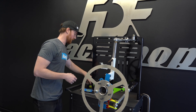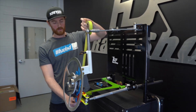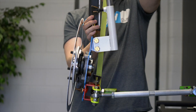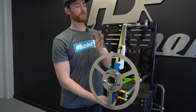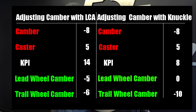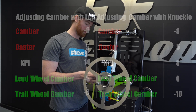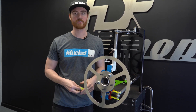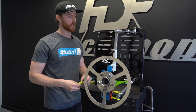Our KPI angle was 14 degrees in the first setup. With the knuckle adjustment we're now sitting at eight degrees — our kingpin inclination went from 14 to 8 degrees. We went from 14 to 8 and made our camber adjustment at the knuckle versus at the lower control arm — two very drastically different numbers. This is an exaggeration, but I can't express it enough: when you adjust things different ways, you're going to get different results. So when somebody's complaining about wheel flop or how their car performs differently, this is exactly why.